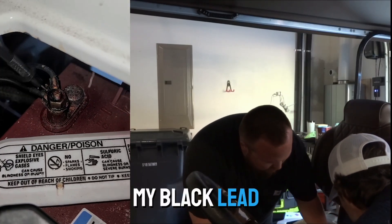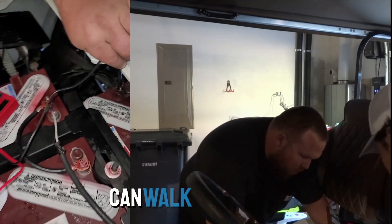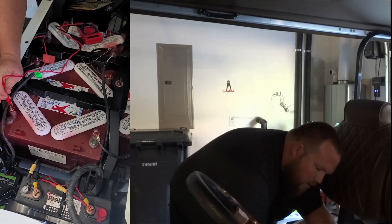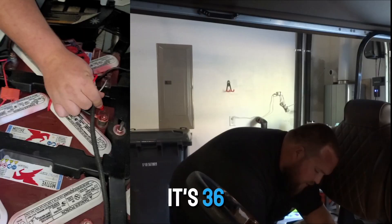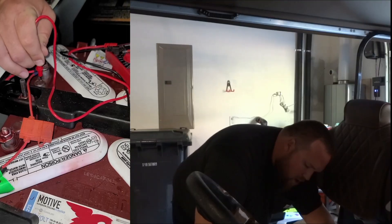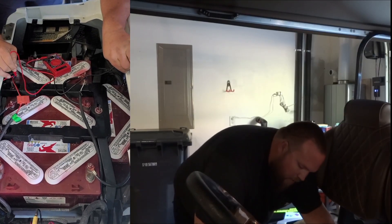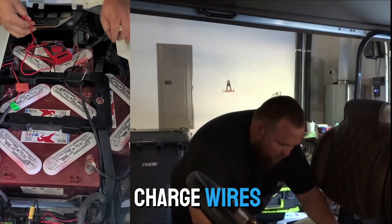So that's where I'm going to put my black lead on my voltmeter, right here. You can walk it around — right beside here that's a 12 volt battery, I'm getting 12.6. Right here that's 24. Then right here on this positive it's 36. And then over here you've got your 48, showing 50.2 volts. On a 48 volt cart you're looking for approximately 48 — might be 51 or 52 volts depending on the condition of the batteries. So right here is going to be your main positive and your main negative based on that voltage reading and your charge wires going to it.